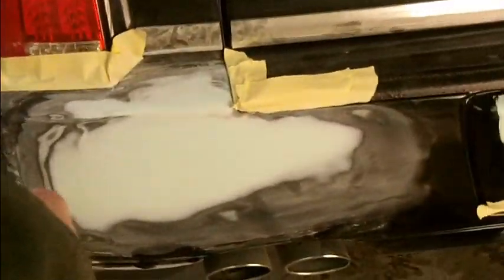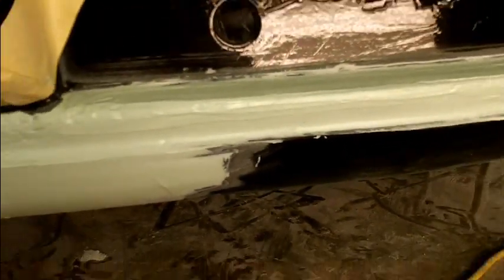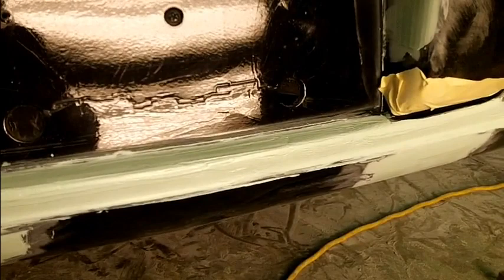Bazam! That side's done. Finished in 320. This side's done in 320. And I've already sanded my first filler off of these ground out stress cracks down in here. This is finishing putty applied with a gloved hand down in this crevice, and then normally with the spreader there, and along both sides on the bottom. This thing's in rough shape. I looked underneath it, and holy Toledo.